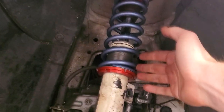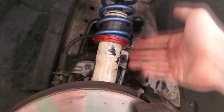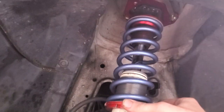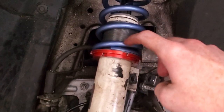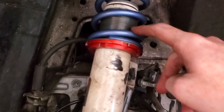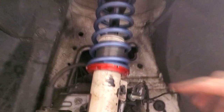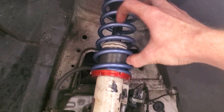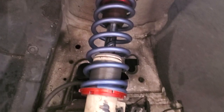On a lot of these European style coilovers, the only adjustment is via the spring perch. The problem with that is that the ride height of the car is more or less dictated by how stiff your springs are and how much you raise the coilover perch up. Unfortunately, with softer taller springs like I've swapped to for daily driving, lifting this spring perch up actually binds the spring — you're actually compressing the spring even at its most uncompressed form, which makes the ride of the car worse.